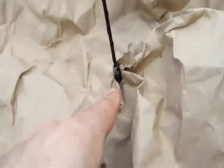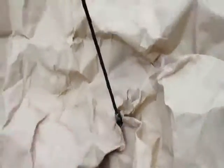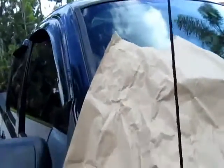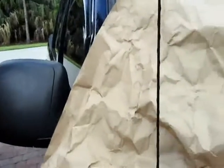So I had to do something. If you don't want to take off your antenna — this antenna is broken on this truck, it won't come off — you have to take the whole cowl piece off and hold it on the bottom, and then I might be able to break it loose. So what you do is this: you get brown paper, you poke a hole through it, you put it down, you catch the overspray, and then when you're painting, you get yourself a piece of cardboard and you make a little blocker, and you just go right down, and you don't get anything on your car.